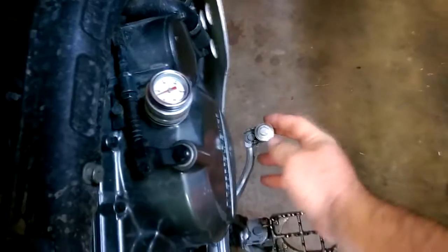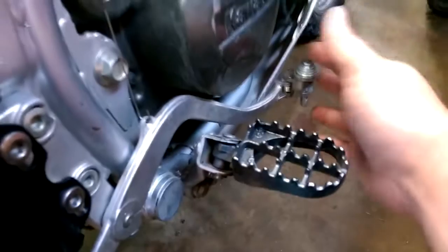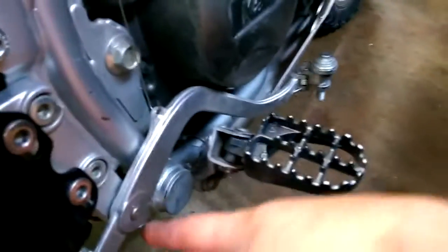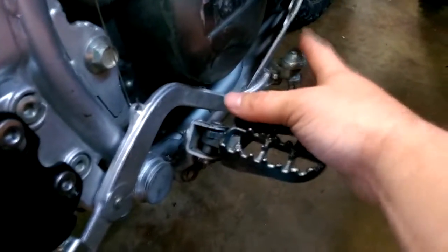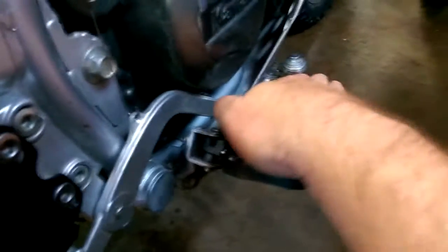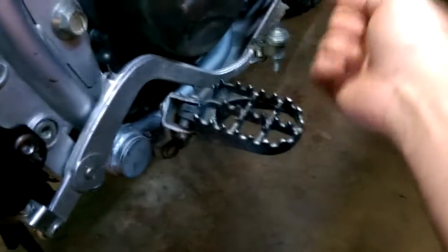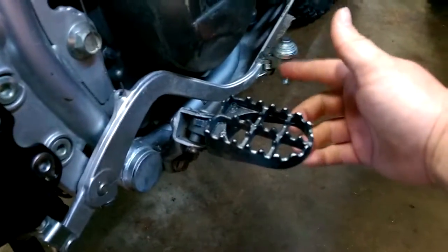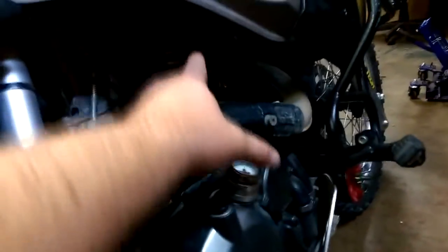Down here I've got a bolt because the KLR has a common problem where the foot brake doesn't come up high enough to engage the brake. You can see I've got it adjusted all the way up — it's almost hitting the frame. I had to add this to raise it up a bit so when I'm standing up I can actually hit the brake without pushing all the way down. I didn't have to modify the foot brake itself, I just put the bolt right through it and it works well.